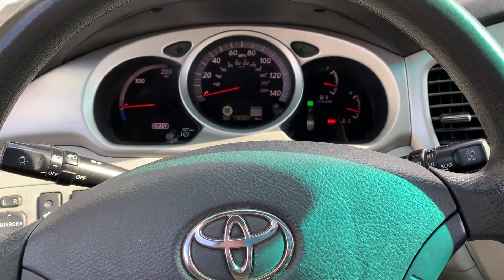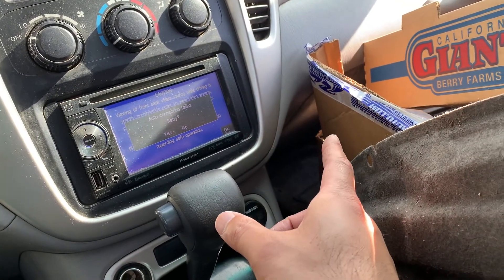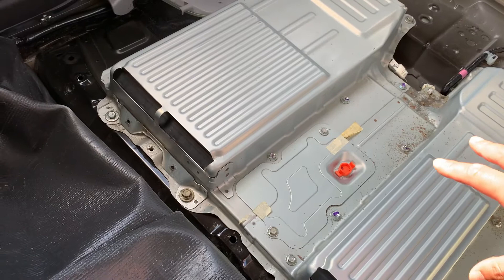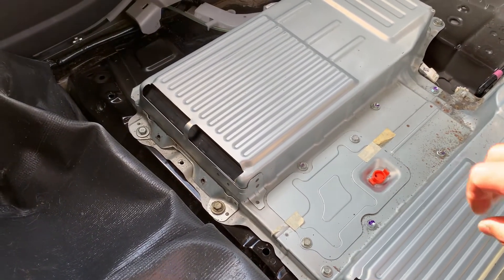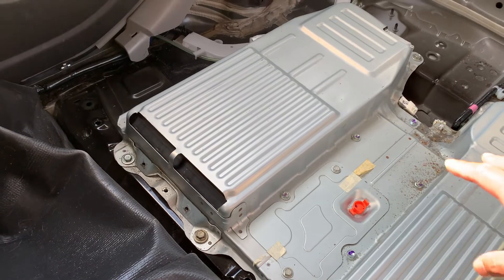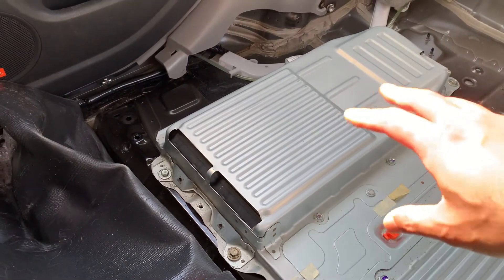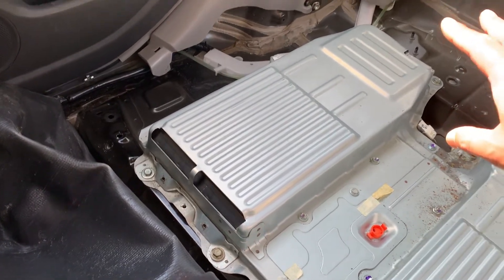I put the battery pack together, so let me run through the scenario. The main ECU is here and it connects back to the battery ECU in the system. P3105 means the communication between the two is not good — it's staticky. Thanks to Super Mario Diagnostics for providing the full diagnostics. When they see a sine wave or some waveform that's really staticky, that's when the communication fails.